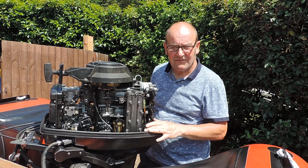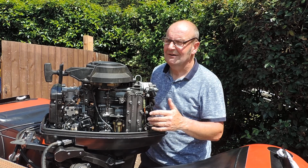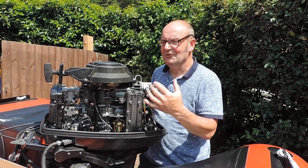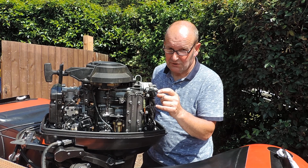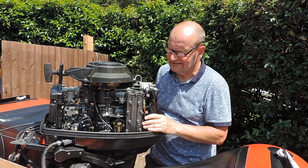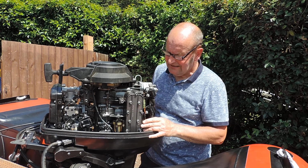The cylinder that wasn't firing now was the bottom cylinder. So again, off come the carbs, checked them again, and I knew every orifice was clear. Set it to the 12 to 14 float height setting they tell you. Bought manuals for it with all the settings in.